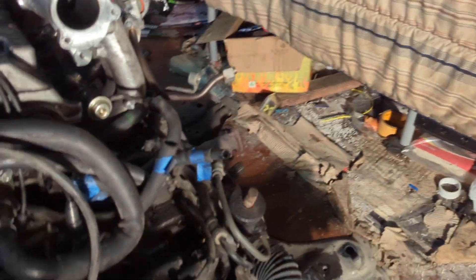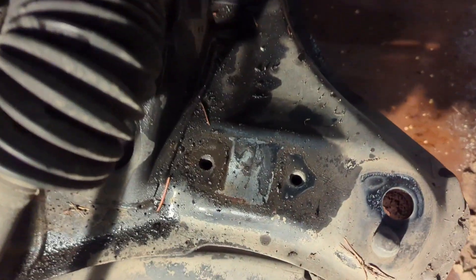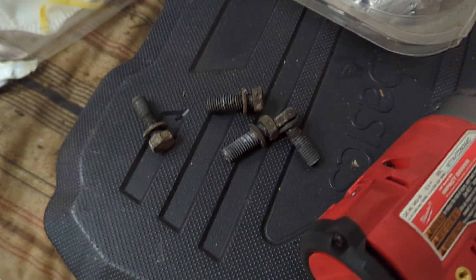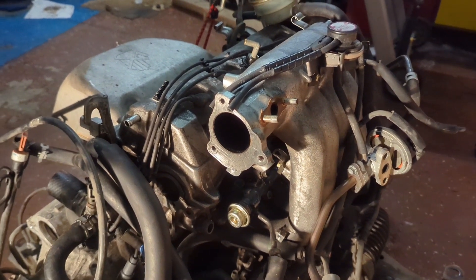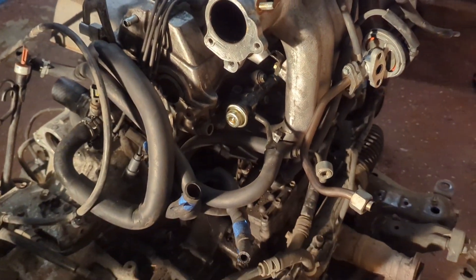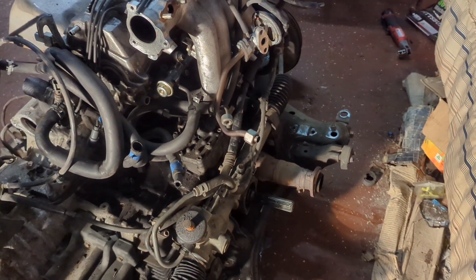If you're gonna lift it out of the cradle you are gonna have to disconnect your sway bar. The brackets are right there — they're held in by two 12 millimeter bolts apiece, four total. Then you're gonna have to take your steering rack out. So right now I'm undoing the tie rod ends and then I'm gonna lift the rack out. I think I'm gonna try and lift it with all the lines and everything still attached so I hopefully don't lose a drop of power steering fluid — not that it really matters since I'm gonna be changing it anyway, but that's not a mess I want.